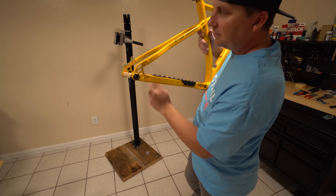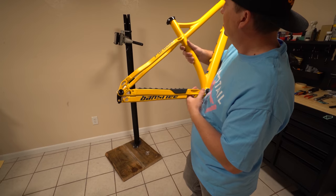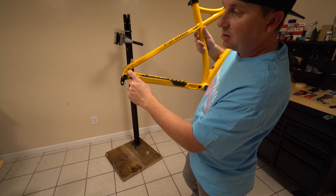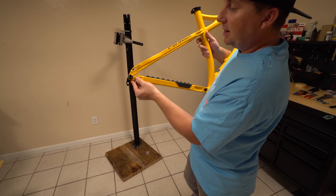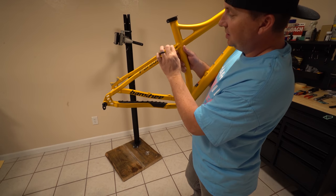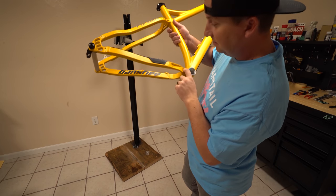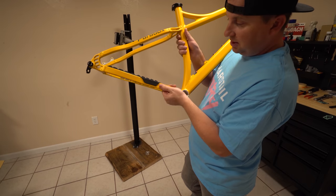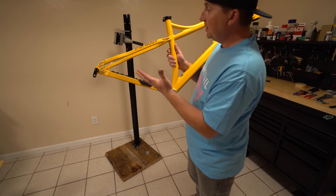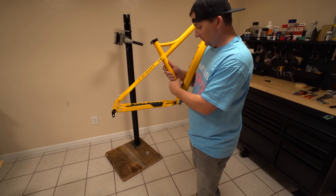I'm a little bit disappointed in that paint in there. I like that they've machined the brake mounting surface here. There's some really cool small things they're doing, like putting in flex here — by cutting out all of this extra material, it keeps the axle area from being too stiff. Same with right here: we've got a thin parallel triangle to allow it to flex a little bit and have some give. Same thing down here, and it's also hollow in there. These are machined out as well — so it's not just for weight savings. It's to allow the frame to flex intentionally vertically but still be stiff side to side.